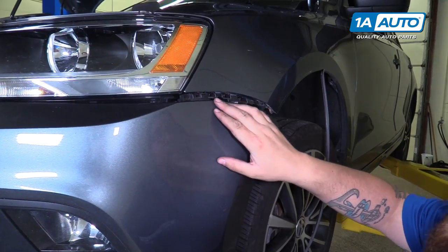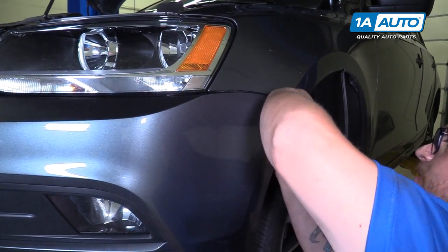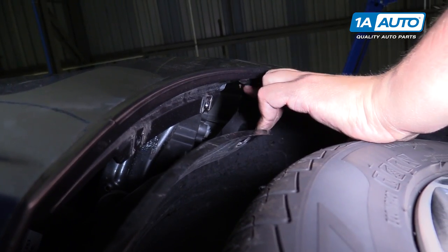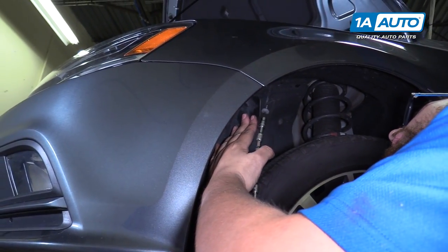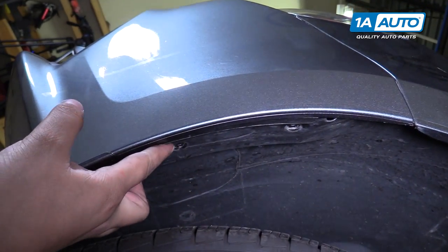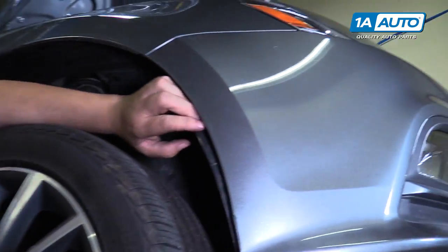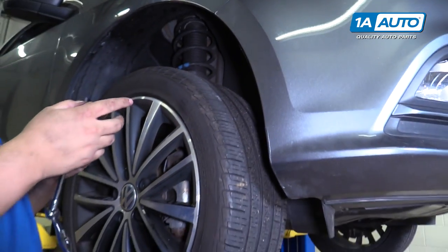To place the bumper back onto the brackets, which have clips all along the top, make sure it's aligned underneath the headlight and press it back into place. To reinstall the hardware into the bumper, start with this one up here, as the liner actually attaches to the other screws that go into the bumper. To attach the liner back to the bumper, there are three screws — one here, one here, and then one on the inside right down here. Do the same on the other side, then fold the liner over and put your three T25 bolts back into place.